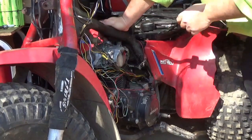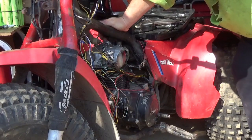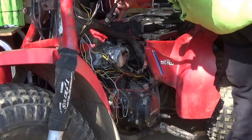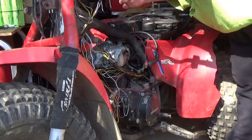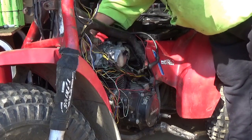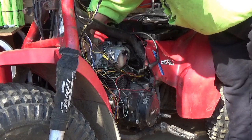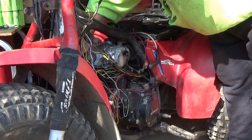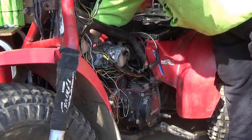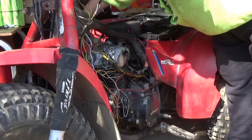Remember, these things don't have to be crazy tight. So, what do we have left? Let's put a spark plug in this thing. Give it a nice hoot of starting fluid. And hope for the best. Maybe it'll surprise us and start. I think not. I think it's never going to start at 45 psi of pressure. Right, I think that's just too low.